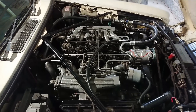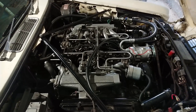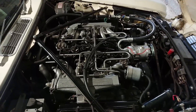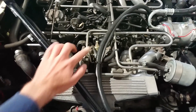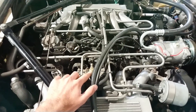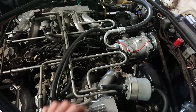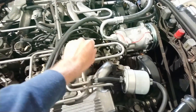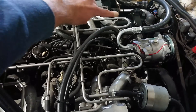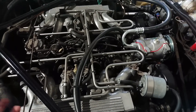This is what a D-Jetronic V12 looks like. They should be D-Jetronic from 1975 until 1980, but here are a few easy ways to confirm. On either bank you have fuel pressure regulators — on the later system these are up closer to the rail, not on the inlet manifolds. The fuel rail is also a round pipe that goes all the way around in two separate fuel rails; on later cars it's one U-shaped rail. Basically, the more spaghetti your fuel rail looks like, it's a D-Jetronic system.